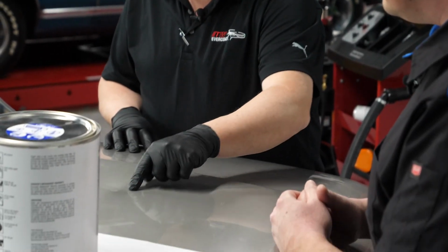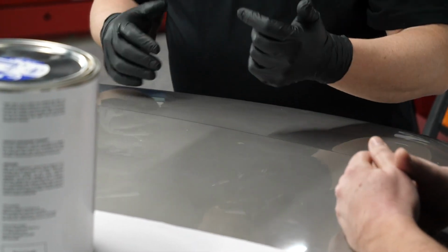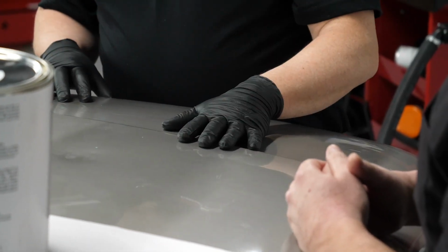So what I'll do on this is I'm going to start in the area here. I'm going to sand with 80 grit just to kind of take off for the deeper areas. Say if I did have to do a stud in the middle or do some hammer and dolly work, and then I'm going to feather edge the outside up with 180 grit to get it prepared for the Rage Ultra.